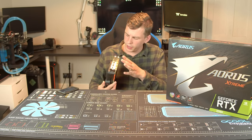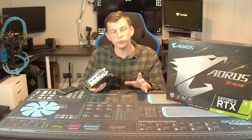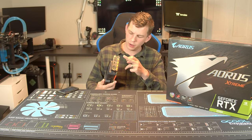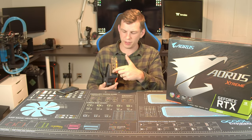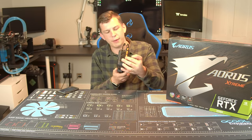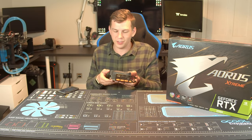Taking a quick look at the rear I/O: it comes equipped with three HDMIs, three DisplayPorts, and a USB-C. However, you cannot use all seven at a time — the maximum is five at a time. You can either use two HDMIs plus one HDMI, one DisplayPort, and one USB-C, or you can use two DisplayPorts plus one DisplayPort, one HDMI, and one USB-C. There's a little symbol on the back linking certain ports together — you can either use one row or the other, not both simultaneously. Either way you can connect up to five monitors.